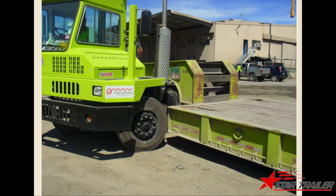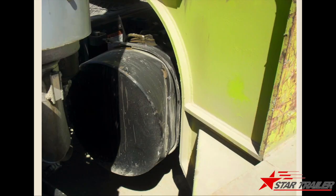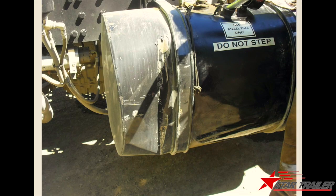There's another thing — you need to design the trailer very carefully. Here is an example: if you are using a fixed gooseneck trailer, you need to consider the turning position, which is the position from the kingpin to the end of the gooseneck. If you are not thinking about this, you might have some problems — there would be some scratch when you are turning. So if you give it a long enough distance, you can turn it very easily and won't have a problem, as the picture shows.